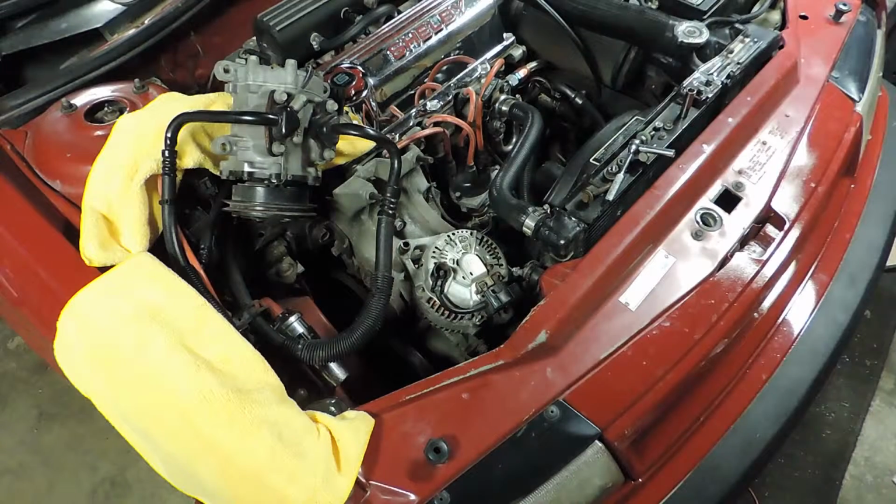One tip that I like to give people, especially if you're going to be daily driving these things still in a cold climate with a lot of salt, go ahead and spring for some stainless nuts, and that'll really save you a lot of heartache down the road. These studs do tend to corrode pretty badly, especially the field terminal studs. So putting some sort of anti-seize or other corrosion protectant on there and using some stainless nuts will pretty well prevent that in the future.